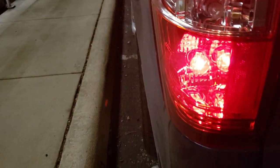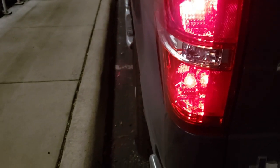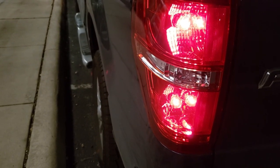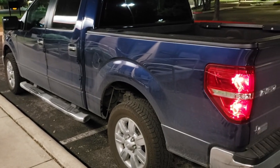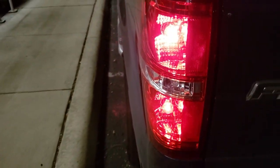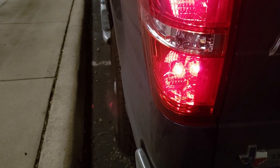The problem was my right signal was not flashing, and when you hit the brakes, the lights weren't getting brighter. The brake light and the signal weren't coming on, but the running lights were coming on. All my bulbs were good. That's the first thing to check. Sometimes people think that you see your two bulbs look good — there's an upper one and a bottom one and there's obviously the little tiny white reverse light — and when you've checked all those and they all light up...